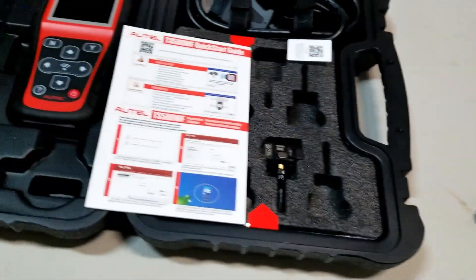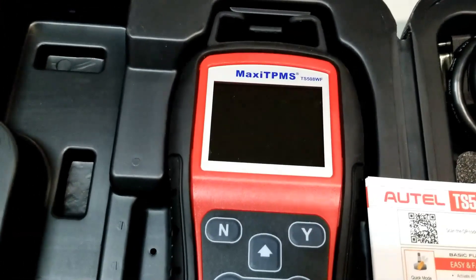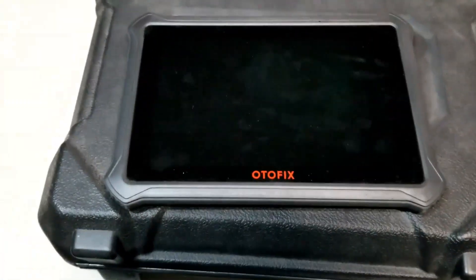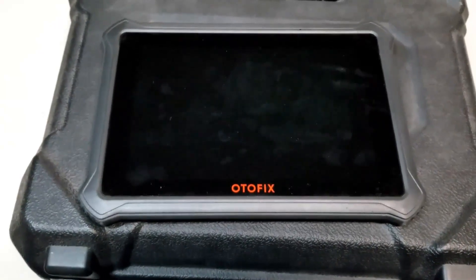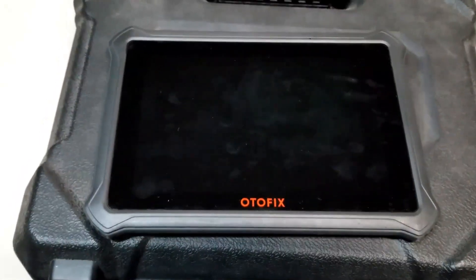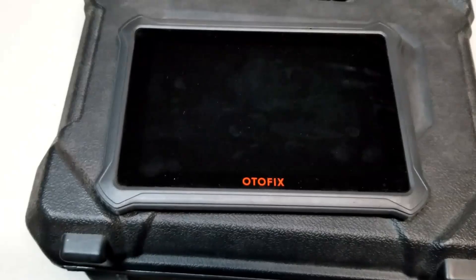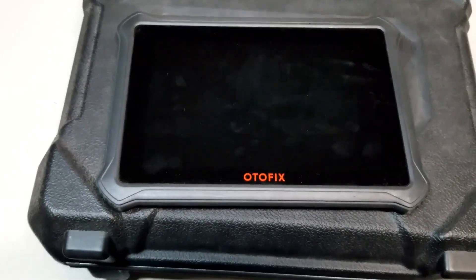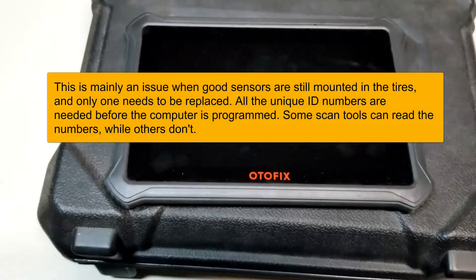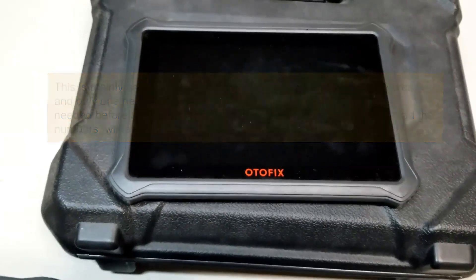To do this you're going to need some tools - there's a lot out there. You can use a dedicated tool like this Maxi TPMS, which is the one I'm going to be using. But you can also use a dedicated scan tool. Some scan tools have the option to reprogram the main computer with unique identifier numbers. Most people don't go this route since these are the more expensive scan tools. For example, the Autel D1 Lite has an option to reprogram the computer with new TPMS sensor unique identifier numbers. It is an option if you have a good OBD2 scan tool.